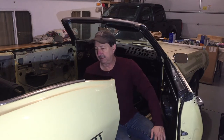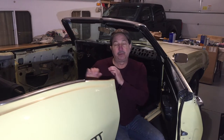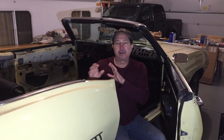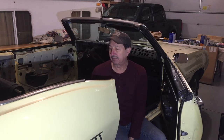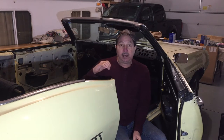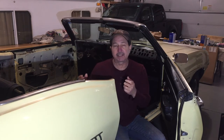Hello and welcome back to Ride Rescue. In this episode I'm hoping I can get these windows back together. The windows were binding up and they were getting really hard to roll up and down. You had to really force them to get them back up. Pretty good chance something was gonna break the way it was binding up. I thought maybe there was some broken parts, but when I pulled all these out in an earlier episode, all the pieces were great. They just had so much grime and grit built up on the little plastic wheels and on the tracks that everything was just catching and dragging.